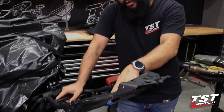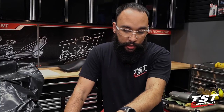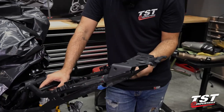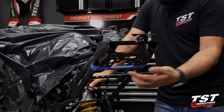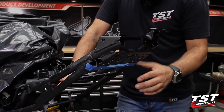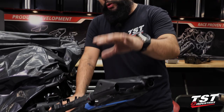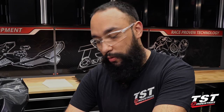All right. So as you can see here, we did go ahead and cut the main tube supports for the subframe, but now we need to go ahead and cut this mounting plate that's underneath. This is actually where the subtray mounts to and where the fender mounts to. So we're going to get rid of that completely — you can see I have it taped off here. I'm going to take the sawzall and cut from in, out and out; that should free this completely. We still have to do a ton of cleaning up here, but we have a really good idea of where we need to be. I'm glad that we finally did this — it was the most nerve-wracking thing for us to do, to actually cut this subframe, because once you do it, you can't go back.